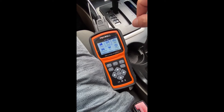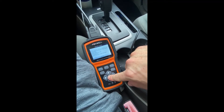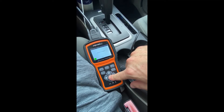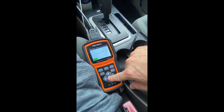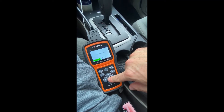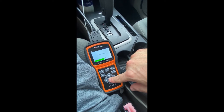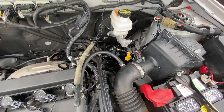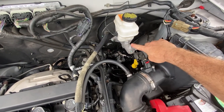It's time to do the automatic bleed from the ABS. Depress the brake pedal and hold it, then hit OK. The brake pedal went down more — now it's bleeding. I can feel the brake pedal pumping as I depress it. Cycle 2. Cycle 3. The brake pedal after we bled the system fully felt a little spongy, so we ended up having to do a master cylinder bleed.